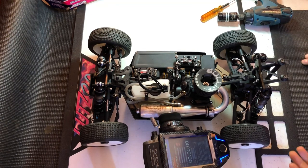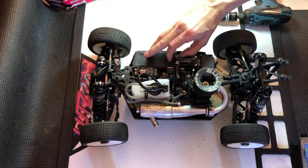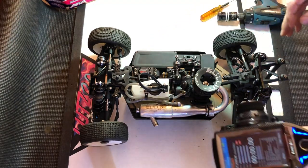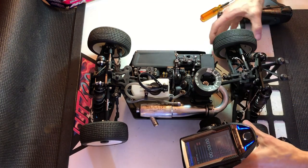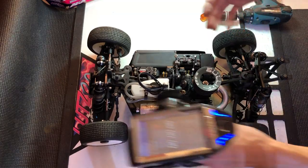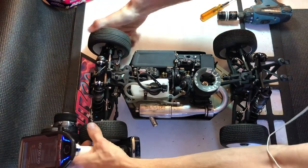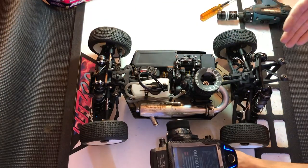What I want to first show you is basically how I feel the bias. I hold full brakes, I hold the outside rear tire, turn the inside, and I feel that — and that's my rear bias. Then I do the same for the front. You might have been able to notice the front was a lot stiffer than the rear.